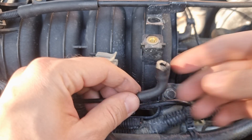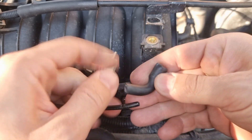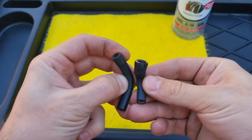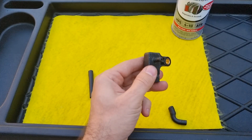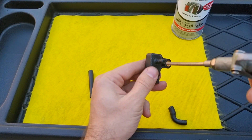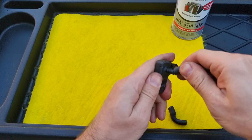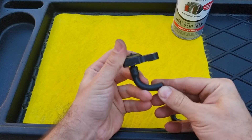Next, we're gonna remove the damaged hose and replace it. You don't have to buy the same hose — you just have to cut a hose of the same size and put it back. Let's make sure the sensor is completely dry before putting it back. I will put the new hose on the sensor, and it will make the job easier for installing on the engine.